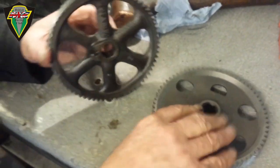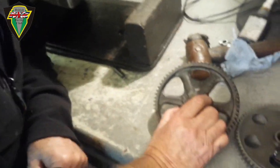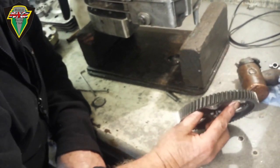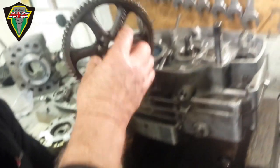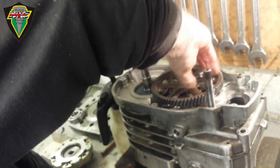I've got two engines, one in. I was talking to Brian earlier about oil changes after meetings — I always drop the gearbox oil. And if you get big lumps you sometimes get teeth in there. It's always been an early warning for me — it's the primary drive starting to lose teeth. Time to take it all apart and check it.